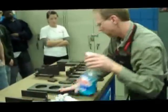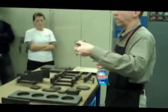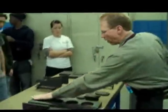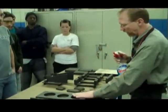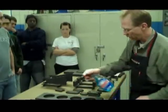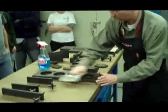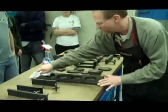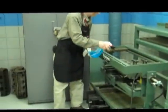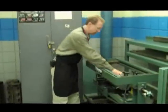These sealing plates are made of cast iron and they've got about a quarter inch thickness of rubber all the way over the whole surface. One of the things you want to do is make sure that's nice and clean, and make sure your head's nice and clean. I'm using a little bit of soapy water — Windex works real well. Make sure that's clean, and make sure the head's clean. You've got to scrape all the gasket off the head; it's got to be nice and clean in order to get a good seal.